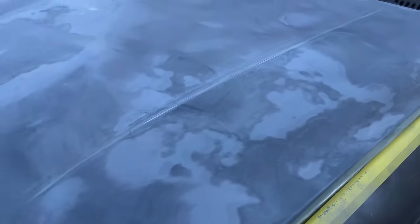I just realized there's a step that I forgot before we started spraying, and that is to use dry tack cloths and tack down the panel before you start spraying. This gets rid of all the remaining dust and small dirt particles still on your panel. You want to do this before you start spraying the primer, and then right before you spray each coat of primer and base coat. Do as I say, not as I do.